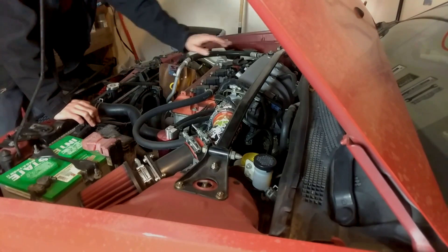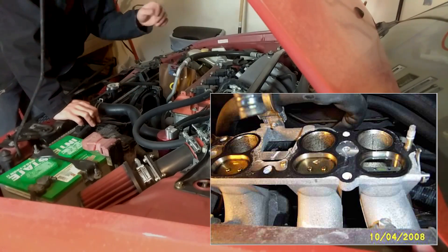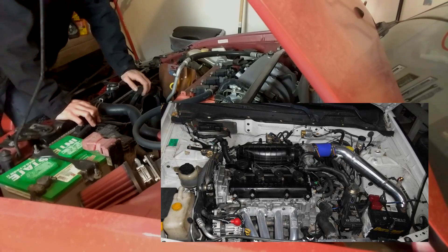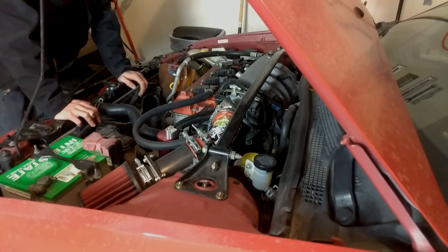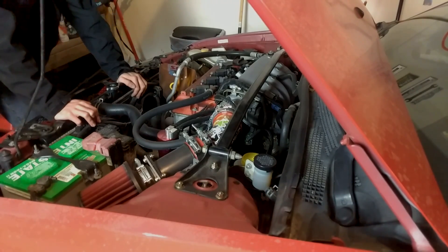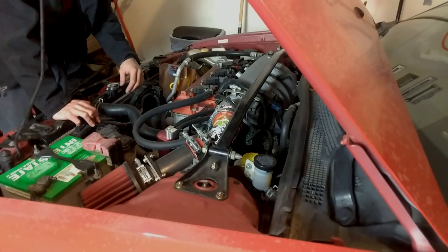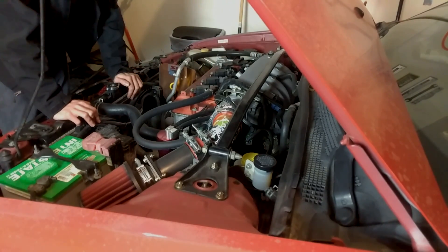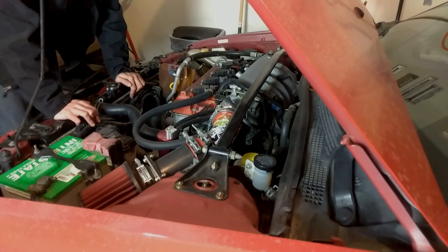It's very common for people to open up this intake manifold and remove those screws, put Loctite on them, and put them back in. There's also people who convert these first-generation QRs over to the second-generation intake manifold, and there are companies out there such as 2J Racing that have conversion kits, but it's a lot cheaper and easier to just Loctite the butterfly screws. With this car, I have not done that yet, so I might actually make a video where I take this off and show you guys through the whole process. It's on the forums and it's very common to do on these engines. Most of the time, if you hear a rattling around 2,000 RPM, that means the clock is ticking and you need to get to it now.